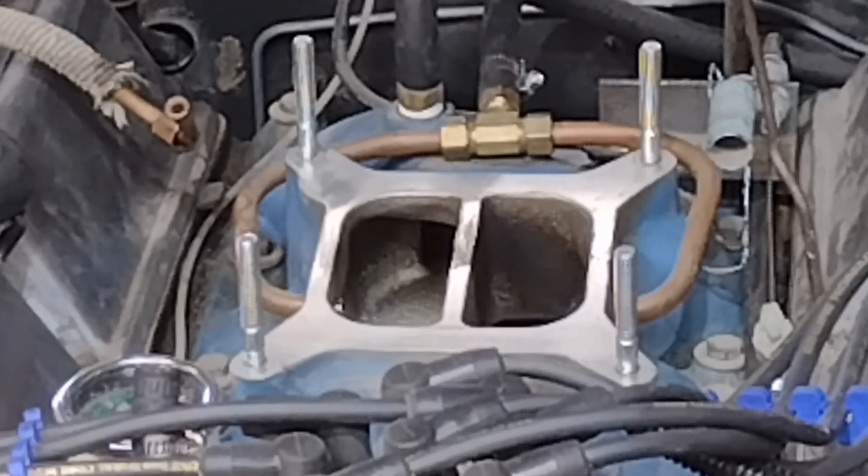What you're looking at is a Ford 289 engine with the infamous Edelbrock Performer 289 4-barrel intake manifold. I say infamous because they're known to be not friendly with Ford carburetors. This video will show you how to either adapt a Ford 2-barrel to this manifold, or how to put on a Ford 4-barrel such as the 4100 and have it sealed.